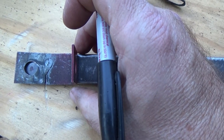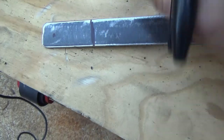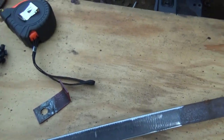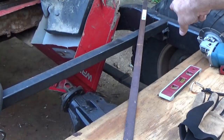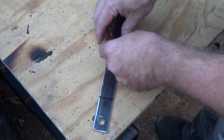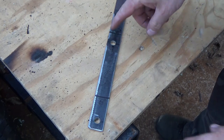If you feel froggy, you can lay your bracket down, mark the center line of your first hole — right here is gonna be your first bend. Then that point is the surface of the core support, and you come back that five and an eighth inch from there — that's your marker line to cut. Before I cut this piece off, I went and drilled my holes first, because it's easier to hold a big piece of metal than a small one. I chose a three-sixteenths drill bit because riv nuts — this size is perfect — so I can use a quarter-twenty bolt to lock it in place.